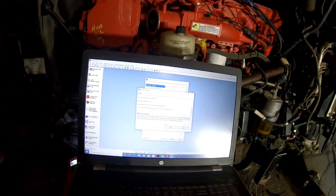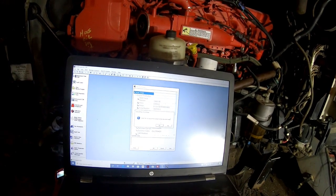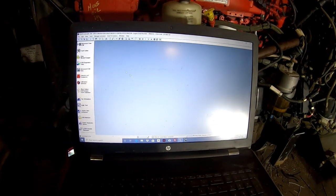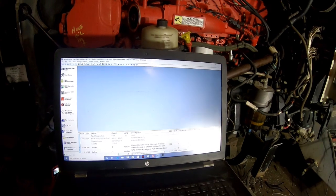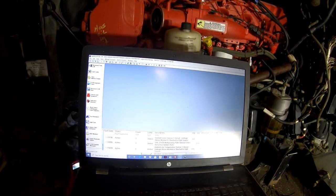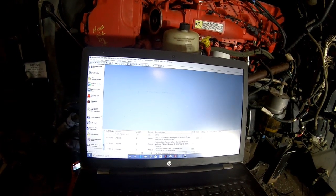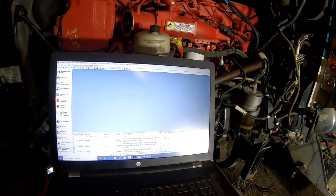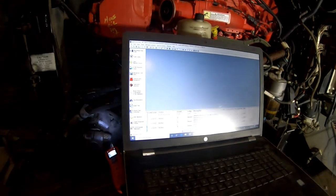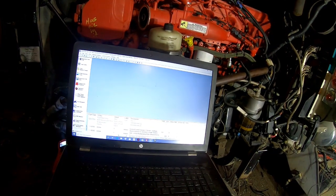New calibration found. We'll hold off on that. I am in, guys. We're gonna have a whole bunch of codes - let's pull up this laundry list. Look at all these codes. Coolant level sensor - of course that's gonna be there. Multiplexing PGN timeout, abnormal update rate. Ambient air temperature sensor circuit voltage abnormal - we don't have one, usually they're out on the mirrors on newer trucks. Crankcase pressure data erratic, intermittent, or incorrect. Let's erase and see what comes right back.